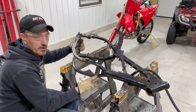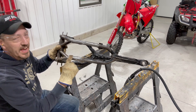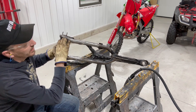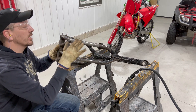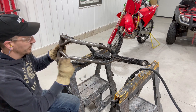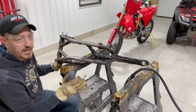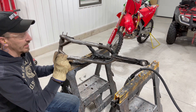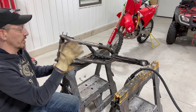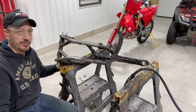We're just looking at the frame rails. There was a large dent here and then a really horrible setup up here, and you guys can see that looks a million times better. We filled in the low spots and really buffered it out smooth. There's obviously some nicks from over the years — I'm not going to fill every rock ding and everything — but we've got the major portion of it out and it's really going to help this frame of Project 93 come together.